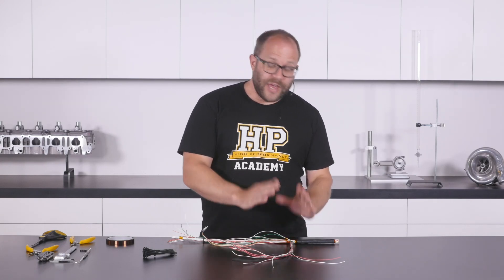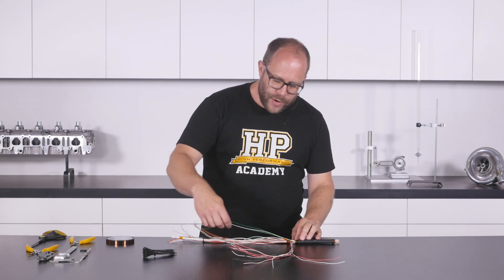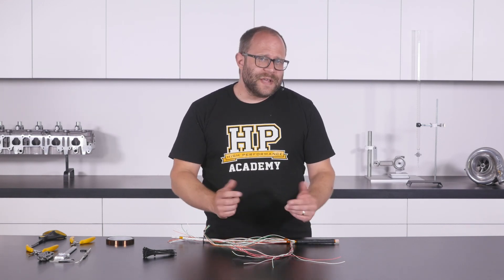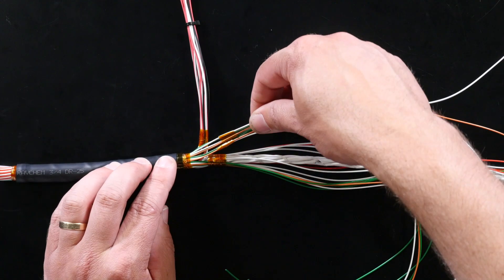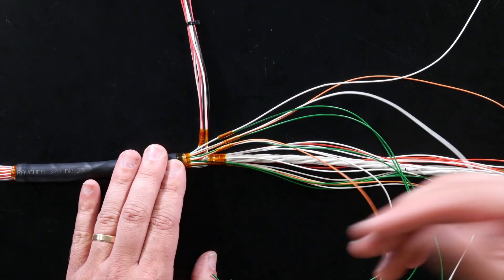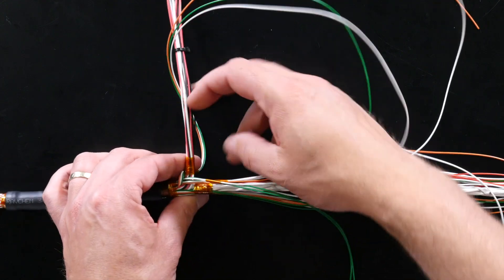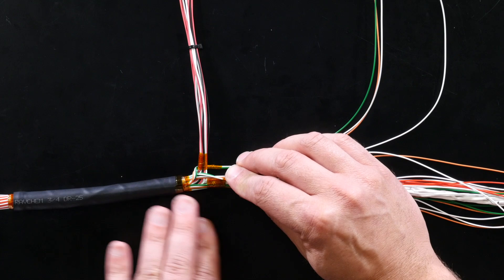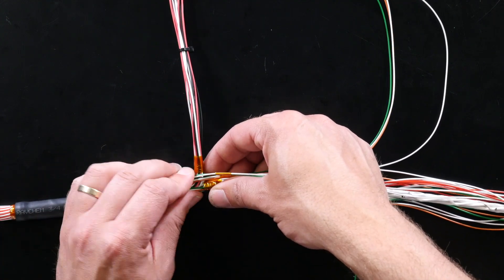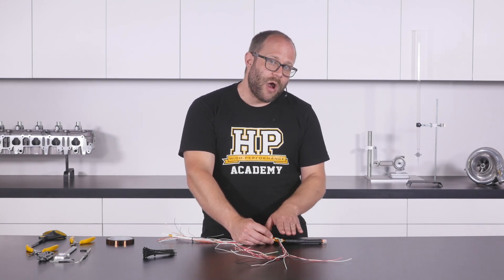With our individual harness sections exiting the branch point now isolated, we need to arrange them in the orientation that we have designed them to be in. That means they will have been designed to exit the branch point in a particular order to make sure that none of those harness sections need to cross over one another as they head to their individual components. For example, if we needed a particular harness section to exit over this side of the harness — in behind our 90 degree exit for our ignition wiring — we would simply twist it around to where it needed to go. You will notice this does look a little less tidy, however what we're really aiming for is for everything to be nicely strain relieved and for there to be no tension left on those wires.